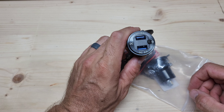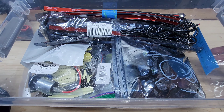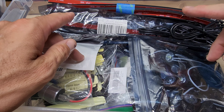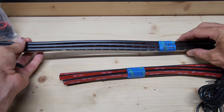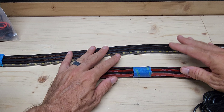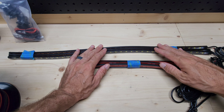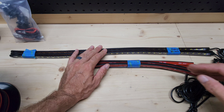I like to cover this voltmeter USB port. It doesn't have to operate on a switch — when I put it in this boat on the switch panel, it won't have a dedicated switch because it has a built-in switch. It'll give my customer a voltage readout on his accessory battery and a way to charge his cell phone in the cockpit.